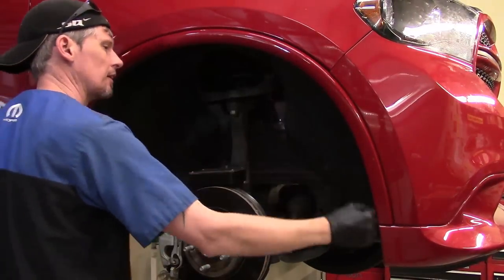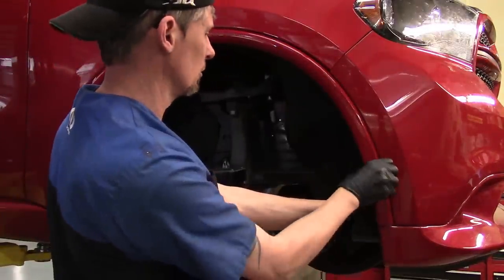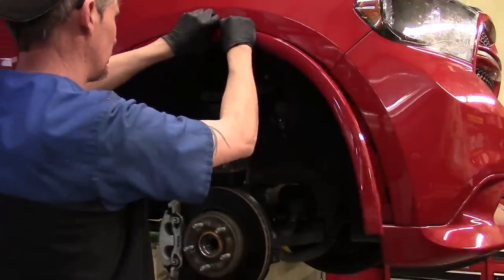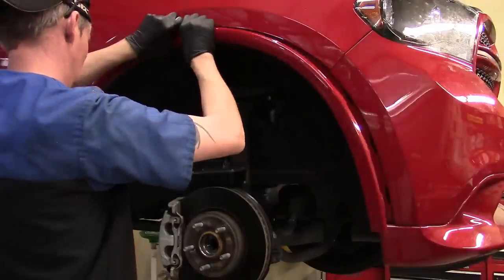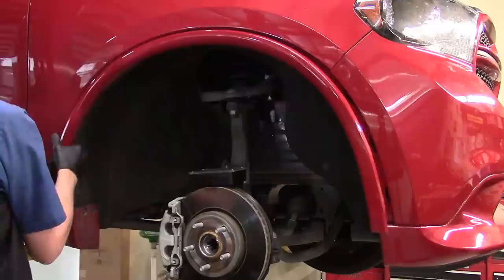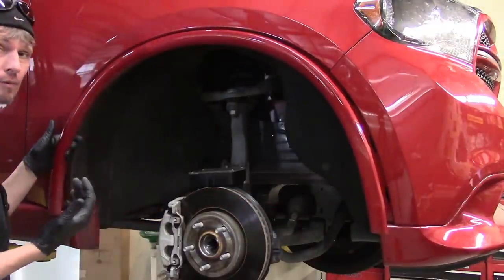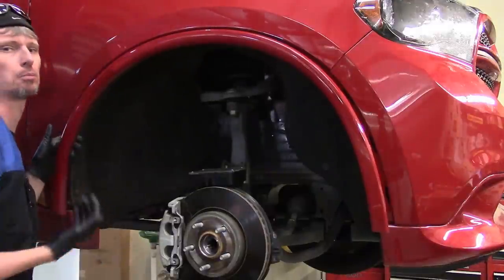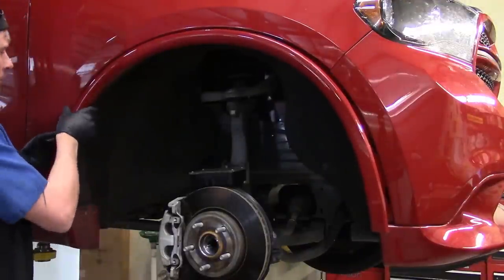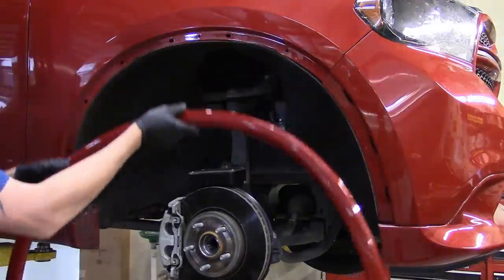The fasteners are off on the front edge going to the front bumper cover. I'm going to grab this and start pulling outward — take your time. You shouldn't have to use any trim sticks; you should be able to do most of this by hand. They are plastic snaps and it may take a little bit of force, but you're not trying to break it or be rough — you've just got to unsnap it. Work it around.